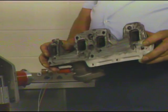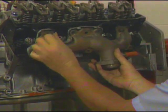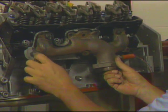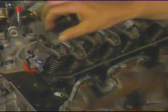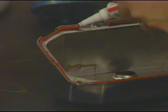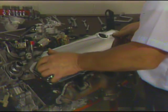The exhaust manifold to cylinder block mating surfaces must be coated with dry film graphite before installation. This coating is also applied between the heat stove and exhaust manifold on the left side. The two upper center bolts that hold the exhaust manifolds to the engine are also used to secure the left and right side AIR tubes. Before installing the outer section of the heat stove, the left side AIR tube must be properly fastened in place. Before the rocker covers can be installed, apply RTV sealant and position the triangular seals in the v-shaped notches at each corner of the engine. Before you position the rocker arm cover, apply a continuous bead of RTV sealant on the cover sealing surface. Press the rocker arm cover into position, install the bolts, and torque down to the proper tension.